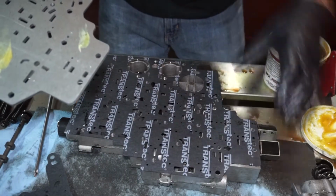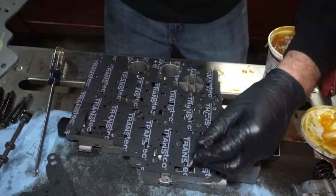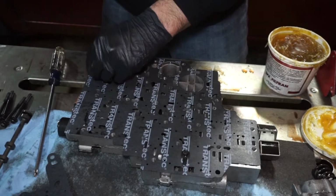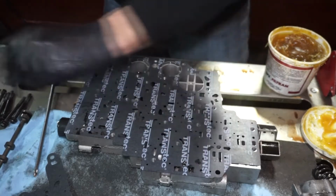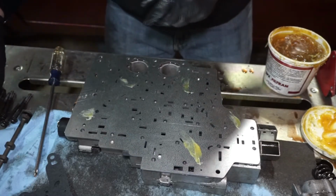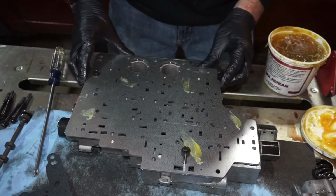This I'm going to get lined up. Make sure that it's okay. They talk about Z holes in the instructions. So there's a hole right here, which is an alignment. It's basically a bolt hole for the valve body, and then there's another bolt hole here to line up your gasket. Now I'm going to put this over the top in the same spot, and I can align the gasket with the valve body and the separator plate. All right.